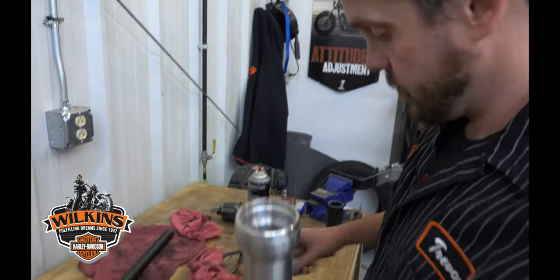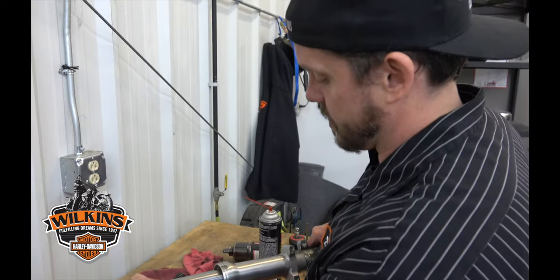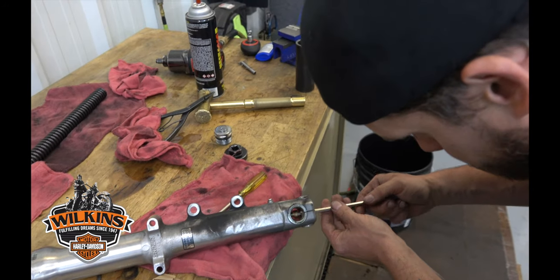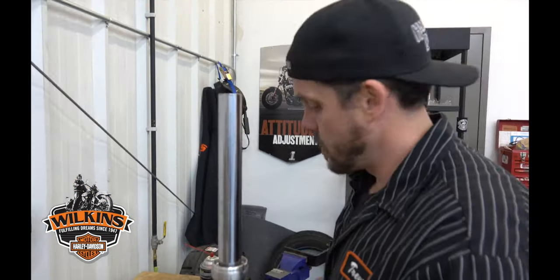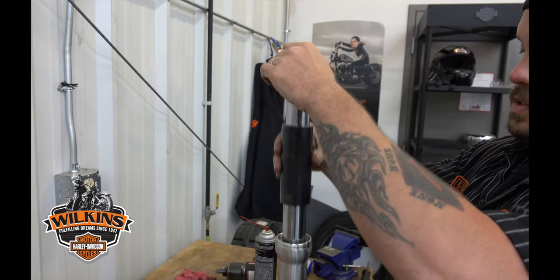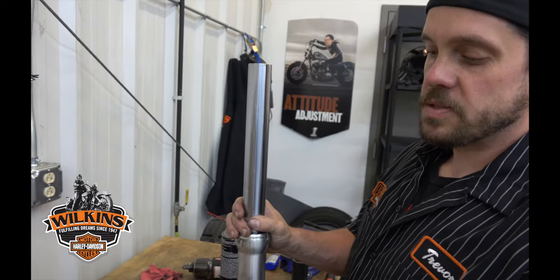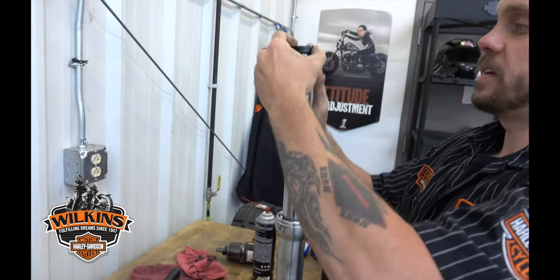It's all nice and clean. Put your new cap over there, and you don't want that cap to slide off so just push it in there and hold this down. Slide your new metal sleeve over. I always let this little slide hammer drop down a little bit to put that other bushing in place — just lightly bring her down. Take your new seal, and this is where a lot of people mess up: always make sure your number side is up. Slide that bad boy over.